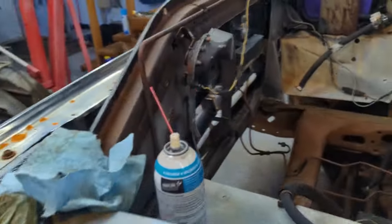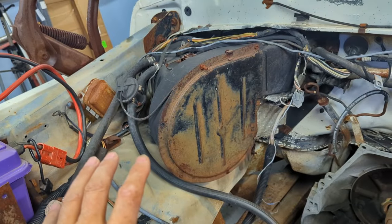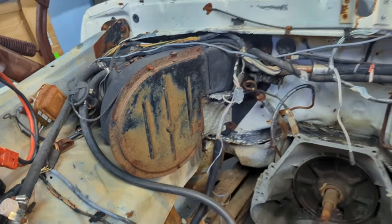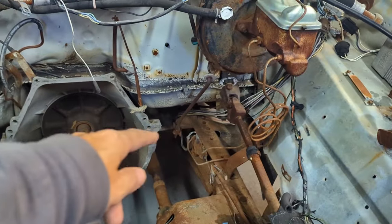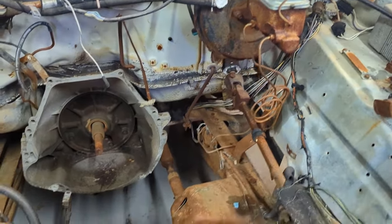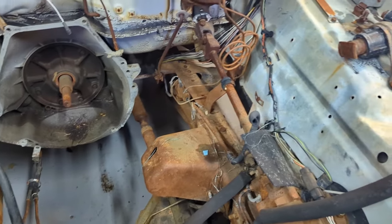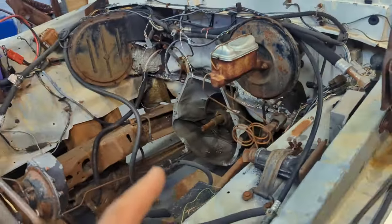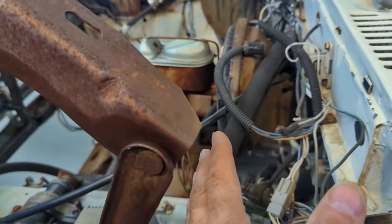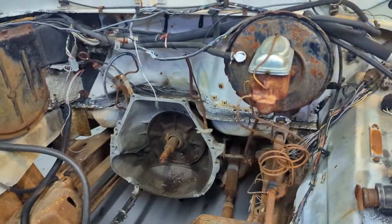The C6 has to be cleaned out, the shaft has to be cleaned up. I want to sand this panel and respray it semi-gloss black. While I have the engine out, I think I'm going to tackle the frame in there — sand it down lightly, give it a coat of rust sealer, and then some semi-gloss black, just because it's easy to get at now. Probably the brake booster too, because with the brake pedal stuck down, my guess is that's going to have to come off so I can lubricate the mechanism. It does have brake fluid in it but it's old, so it has to be drained out — that stuff absorbs water.